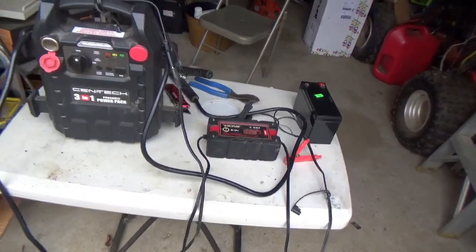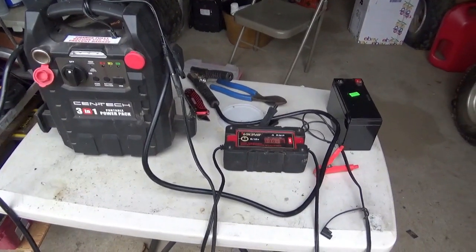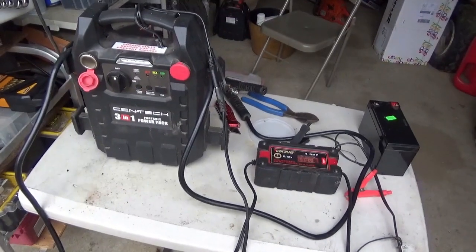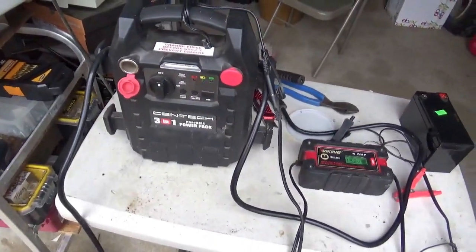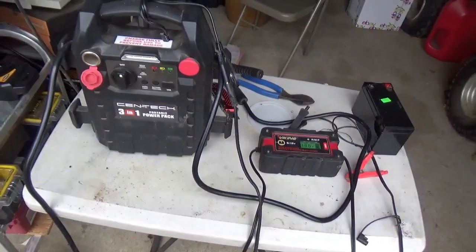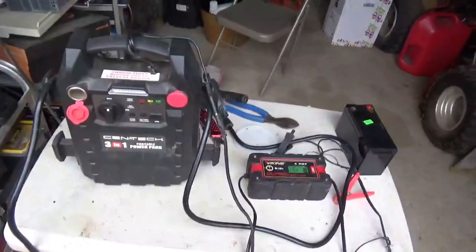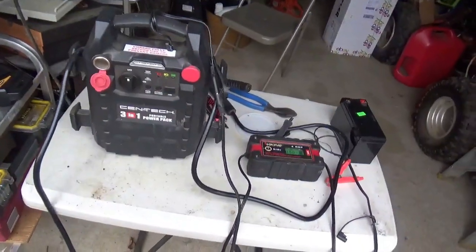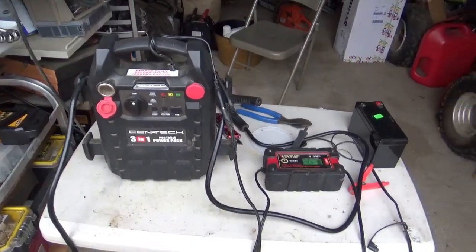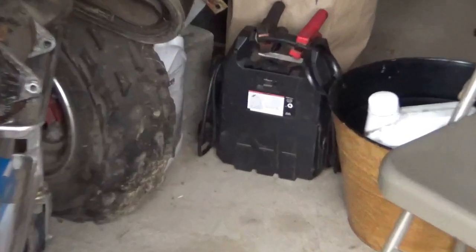So where did the battery come from? I did buy that Mighty Max off eBay — I think it was around $40. Typically you get these jump packs on sale at Christmas for $50 or $60, and the normal price is $70 or $80. You can see it just turned green — now it's just floating and I can leave it plugged in like that and come back to it any time. If you use the built-in charger on the back, you boil the battery out and it becomes useless. The old pack is still over there — only good for ATVs now.